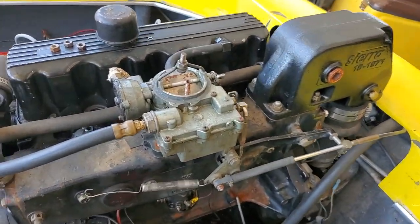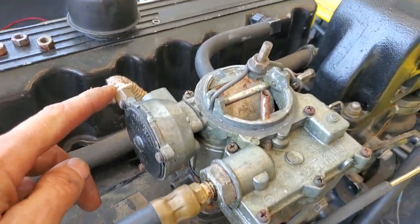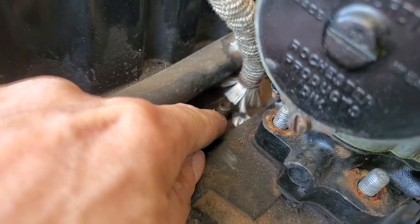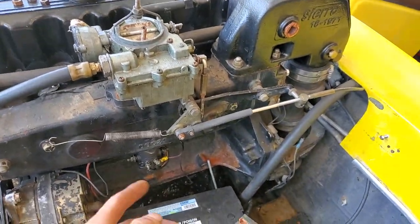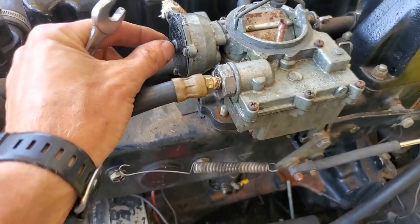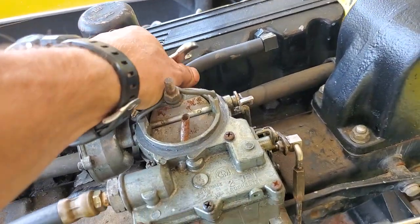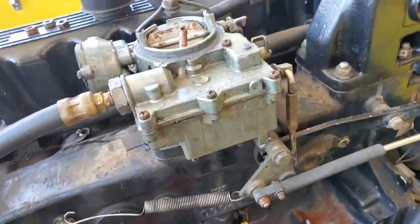A few things to notice. This is a heat hot air choke. It has a hot pipe that goes down into that little hot air hole. It basically goes through the manifold and this one's broken off, so we've got to fix that. Some of them might be electric, so you might have a little wire on there. This is just for the vent — to draw out the gases — and this is the fuel line.